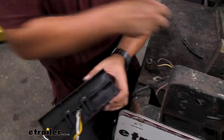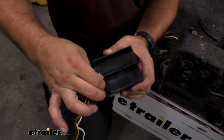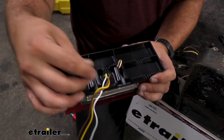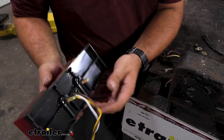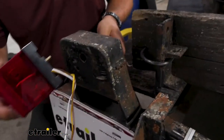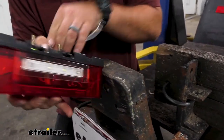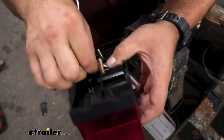Grab the hardware — you're going to have these carriage bolts here, and they just slide up. Once you push a little bit extra, they're going to pop in place and hold there, which is nice. It does allow for just enough room to adjust if you need to on your trailer. With those in place, I've determined I'm going to run my wires over to this side, so I'll just run these up and lightly push them into the channels, and that's going to hold them in place.